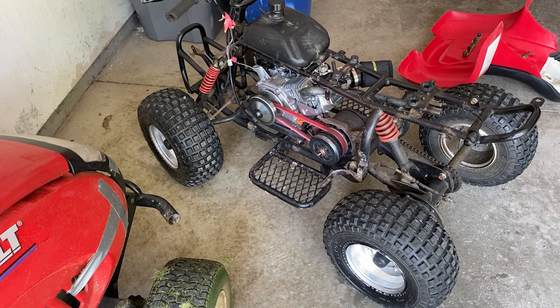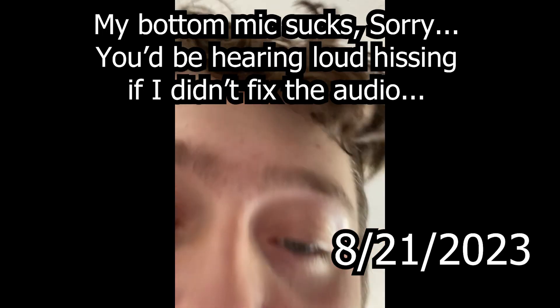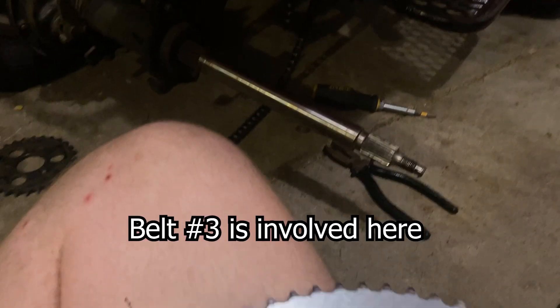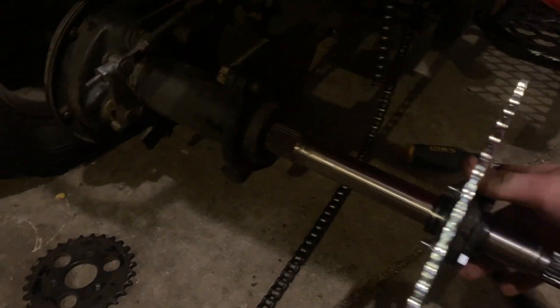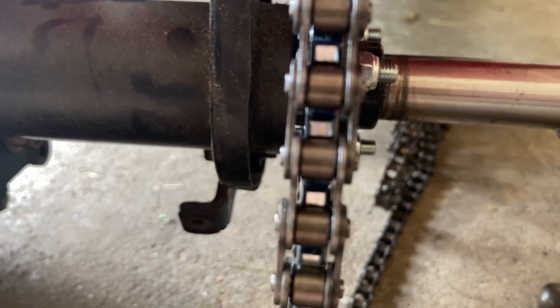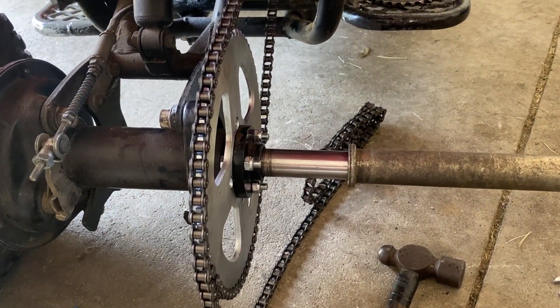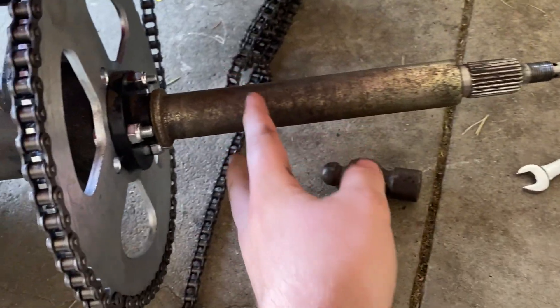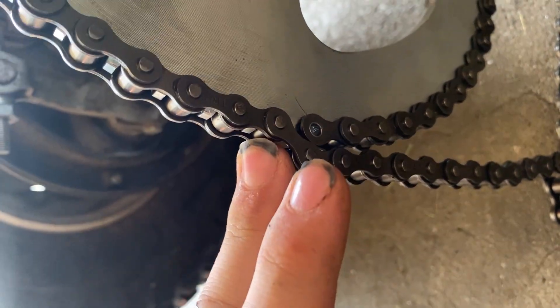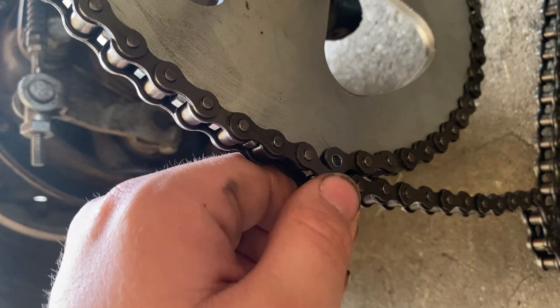I was a complete idiot — the main issue was the sprocket ratio on the chain side of the transmission. So I got a bigger sprocket and here's me installing it. It's bigger than my four-wheeler sprocket, but it'll work. That's a decent amount of ground clearance — I think that's actually perfect; any bigger would be bad. The studs are running into the wheel bearing — that's a problem. I had to put the bolts around on the sprocket adapter so there's a gap between the bolts and the wheel bearing so it can actually spin. I figured out how long I need the chain — I need to stick the master link in but first shorten the chain, so I'll have Cameron come over with an angle grinder to cut that end off.